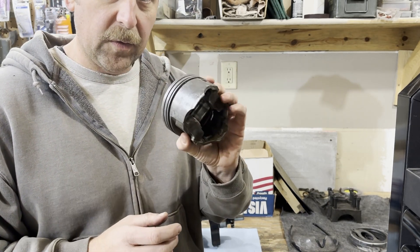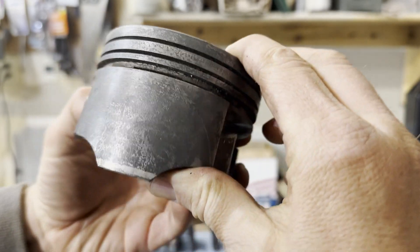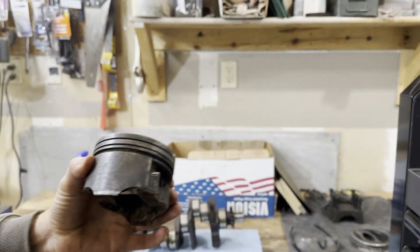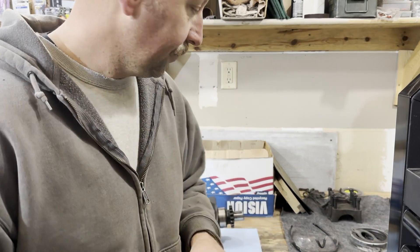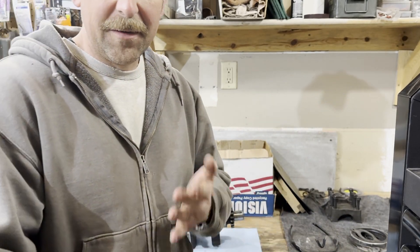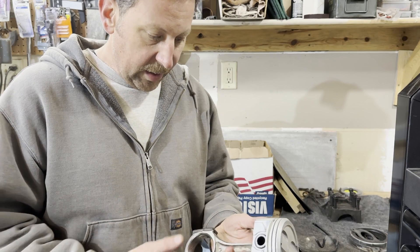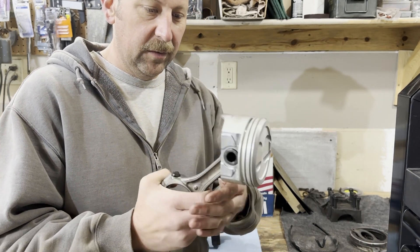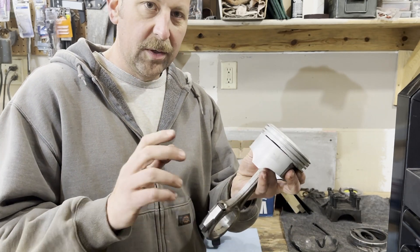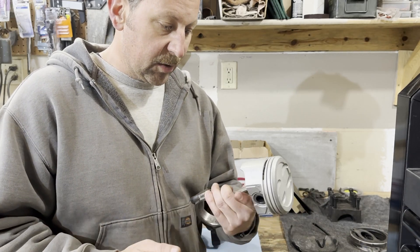Here was our first hang-up. You can see that crack right there, and the matching crack on the other side — that's on one of the stock pistons that came out of the block. I noticed it as I was cleaning them up. I almost just bought one piston and sent it, but then I realized six pistons were about $86-90 shipped. So that's what I did — I got six new pistons, took them to the machine shop to have them pressed on the rods since I don't have the jig for that. The rods were good, didn't need resizing. Standard pistons on stock rods — about $90 worth.